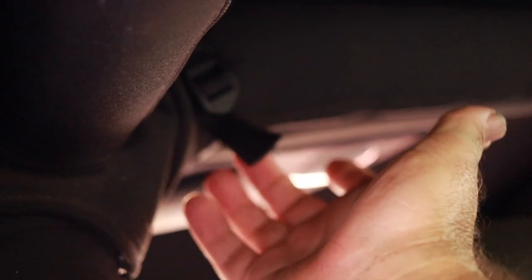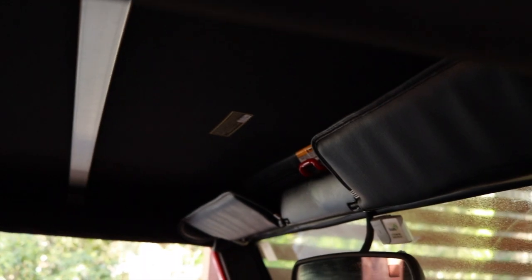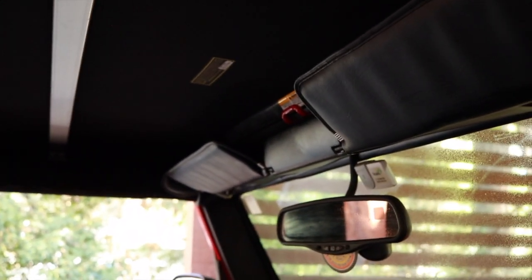I've had some issues after doing all the back up and then trying to put down the Sunrider part and clamp it to the windscreen. In the end what I've had to do — leaving the back all done up — is undo the straps inside ever so slightly to give them some slack, and undo both straps around the roll bar. The idea was that it would give me just enough to do up the Sunrider part to the windscreen frame, and that's what worked. Now that's done I've tightened all the straps back up again.